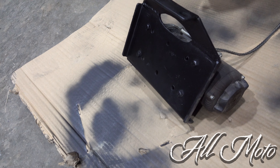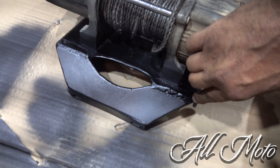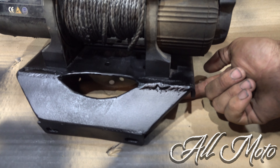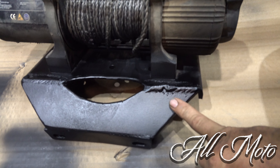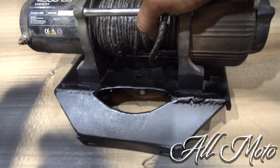This is what I came up with for the winch mount. I cut the winch mount off right here from what it was — this is the original. I bolted this on, put the winch back in there, and stuck a block of wood underneath where it was hitting for the amount of clearance I wanted. Then I measured, cut, and fit this, and tack welded it together. Pulled it out, welded it up, and sprayed a little paint on it so it doesn't get all rusty.